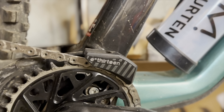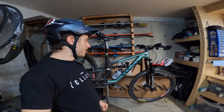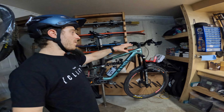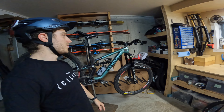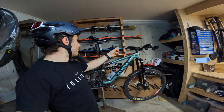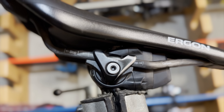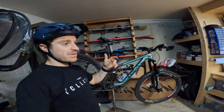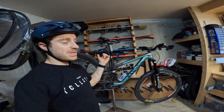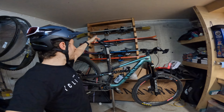I'm running 32 tooth up front with a 10-52 out back, and I'm running these XR cranks just because I think they look sick with the shine there. Normally running silver Crankbrothers pedals but these are the Mallet-Es. E13 guide here. Brakes I can't talk about. Shifter pods — I just love the symmetry of both using the same shifter pod for my dropper post and my shifters, so those have been really cool. For the dropper post remote, I have this 170mm dropper which obviously looks a little bit weird. RockShox just made some custom seat clamps that allowed me to run my seat tilted forward so I could switch the whole apparatus around.